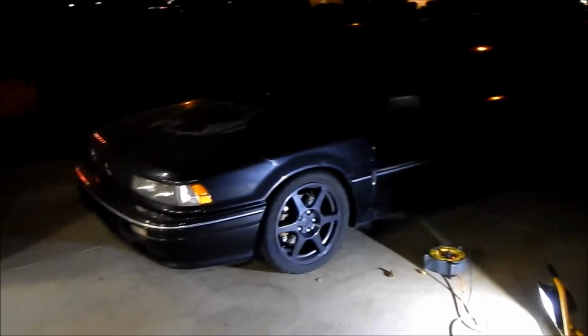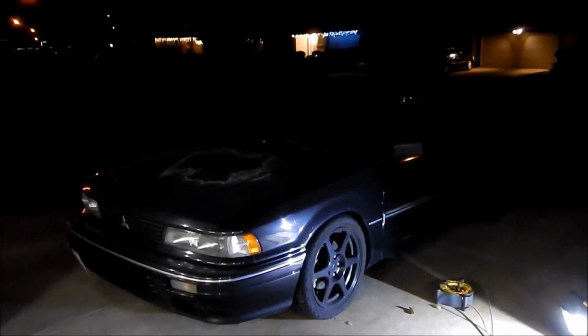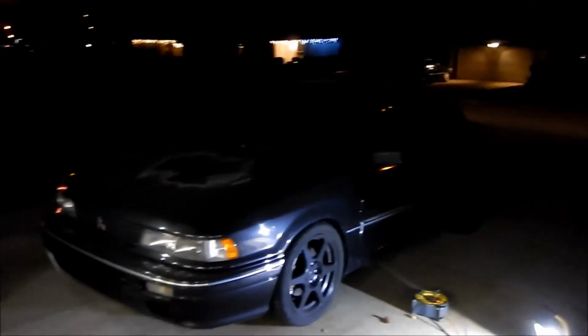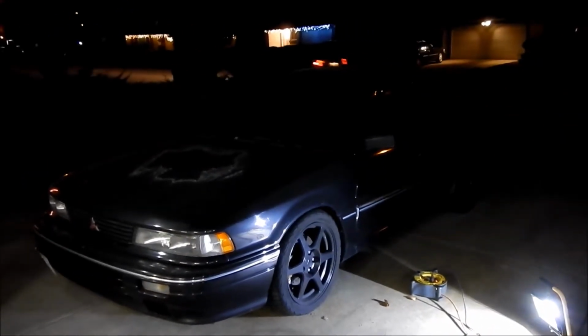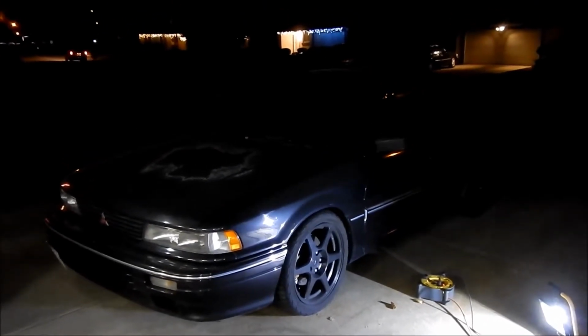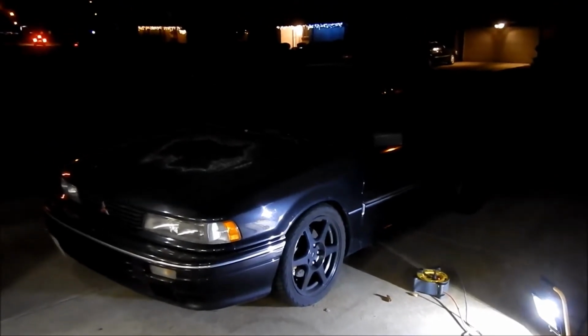I think it would actually be better than the Eclipse, because on the Eclipse I have to actually have the stupid stock O2 sensor connected still. The wire is not sending any signal to the ECU, but it's just there to use the heater function. But the AEM wideband already has a heater function built into it, so yeah, I know where all the wiring is. I need to tap in now. The turbo timer harness is where everything is going to be connected to. So that turbo timer will never be uninstalled. Hopefully, it'll be there forever. And yeah, the car's coming along nicely.